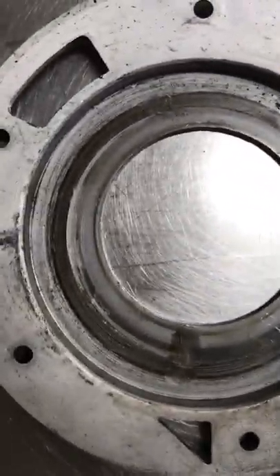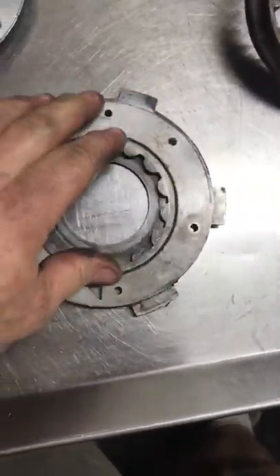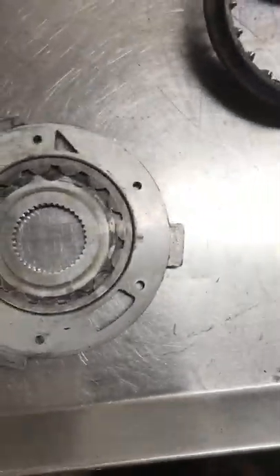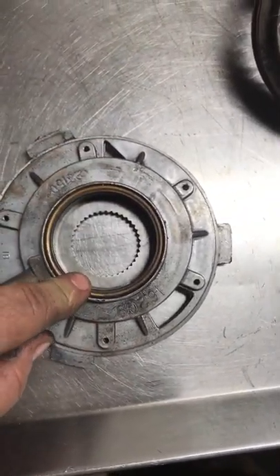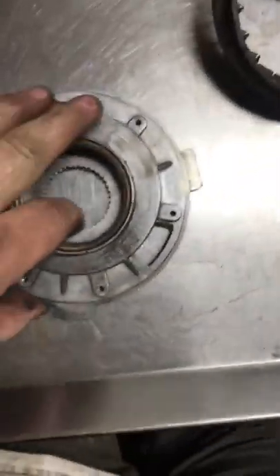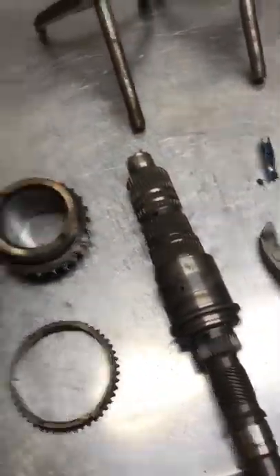What happens is, if you've got a leak and you run it low, it doesn't take long — because you're talking about a super thin cast aluminum piece that has to have super tight tolerances so it fits in there. This face has to fit on top clean so that when it circulates, all the fluid coming in here goes down the shaft and not leaking out everywhere. These seals are notorious for going bad. This one here is rock hard. So oil gets low, pump messes up, pump starves, and then it reduces the flow of the unit.